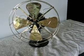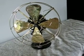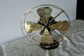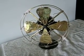This one is fully restored. The only issue I have is a speed coil, which I'm going to probably rewind because it's only working on high speed on both speed switches. It's normally a two-speed fan.